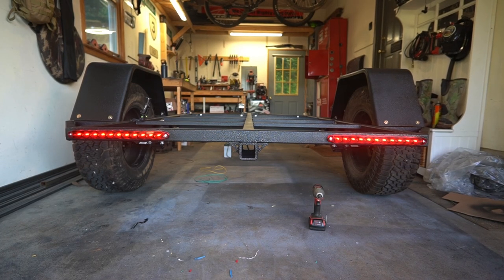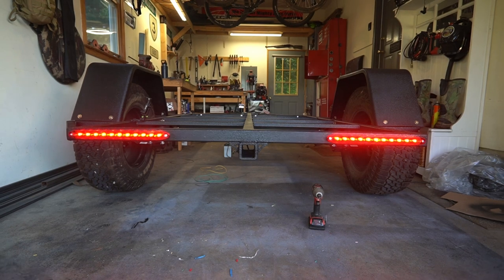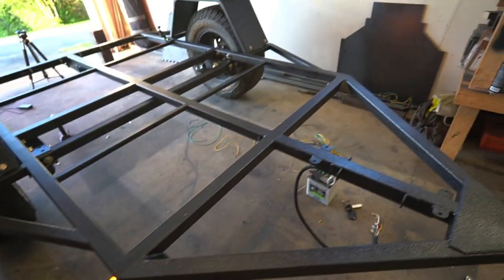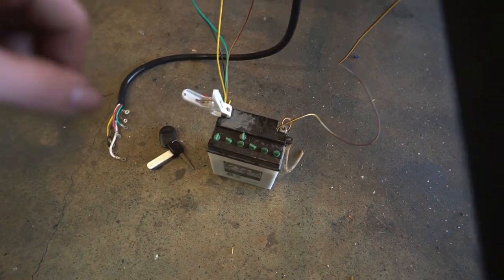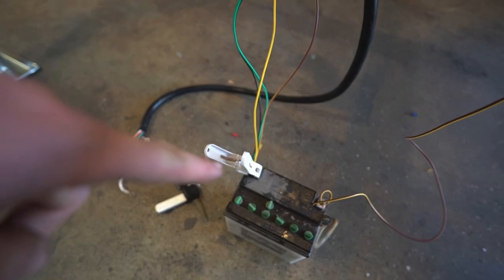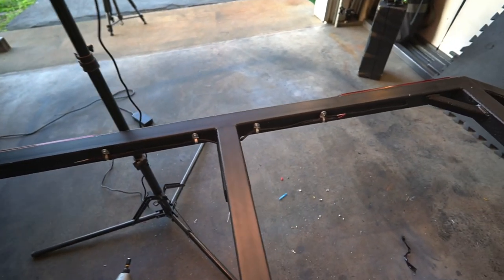Now we're going to do a light test. These are our running lights; here are our brake lights — you can see they're quite a bit brighter. We know our brake lights are functioning, which means our left and right turn signals will function as well. Our front marker lights are functioning too — for their size they're actually very bright, nice and compact, plenty of visibility. To test this I'm using a small battery from a four-wheeler: a wire from the ground post to the trailer grounded to that, and all my power wires going to the positive post, adding and subtracting them to verify which ones are working. That about wraps it up for the trailer wiring.